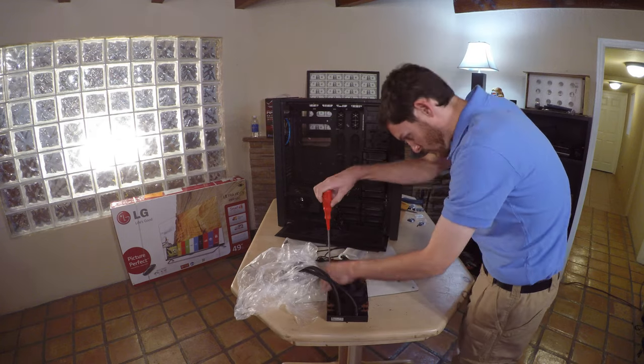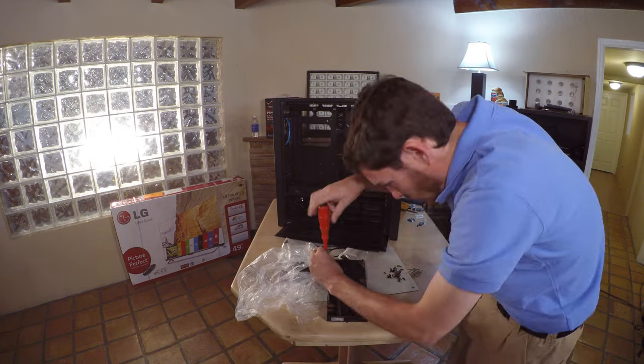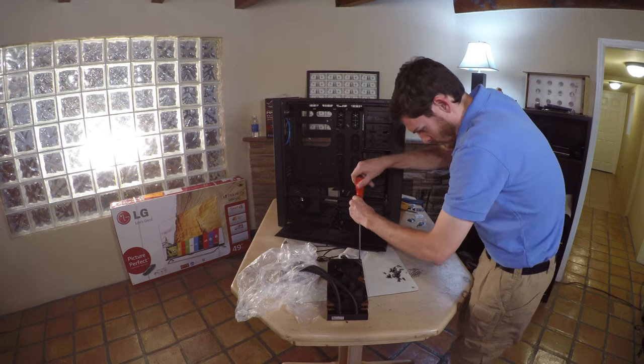And make sure you have the direction of the airflow correct with the push-pull configuration setup. Always roughly seat the hardware, but never over-tighten it. This is a radiator, and you can damage it by not installing the hardware correctly.